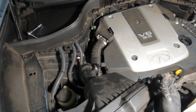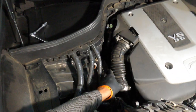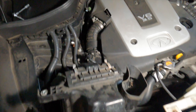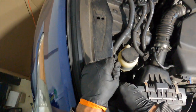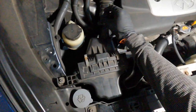Now we're on the passenger side, going to do the same thing. The last air box — the passenger side air box — just flipping it over. We have to connect the hose at the same time to make it easier to get it back into place. Just make sure the bottom is lined up with those grommets. The air boxes are replaced and back in place where they're supposed to go, and everything is plugged up.